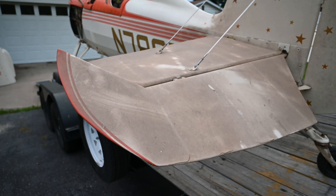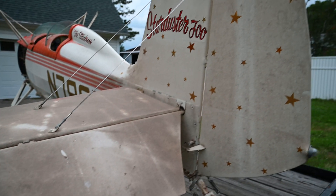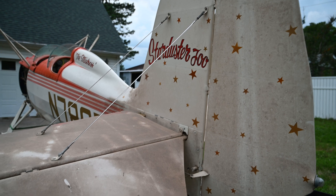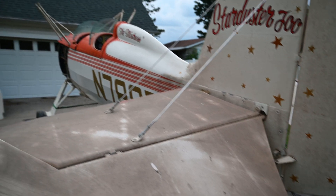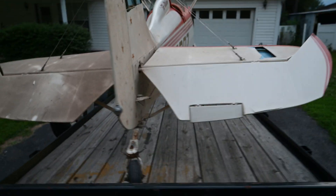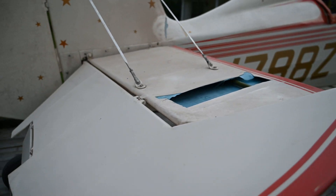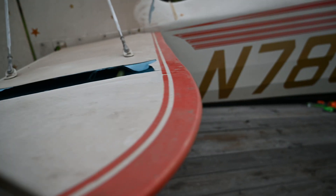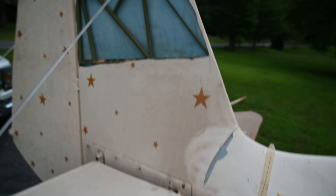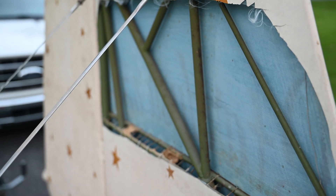You can see for as aged and weathered as it is, the fabric's actually holding up pretty good. There's no real damage outside of the wings from that, and the center section is taken off. It's really dirty but overall looks pretty good. Cutting into the horizontal here, it looks about like the wings did. The metal and everything all looks good. It doesn't have a whole lot of rust outside of some really light surface rust that will be cleaned up and then reprimed and painted.